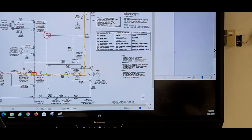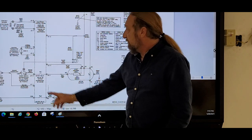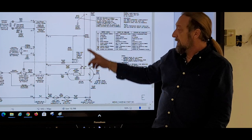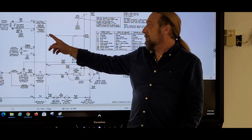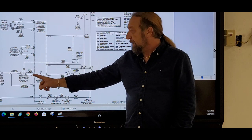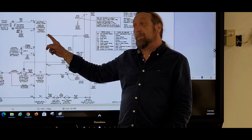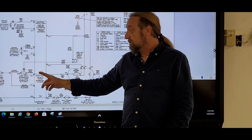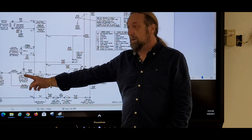Now, how come couldn't you also test the J42 to J41? J42 to J41. Yes, you could, but you're going through the motor. Oh, okay. You could do that, but here's a true neutral. I got you. And you know that neutral is good. So by going here, you're only going. We know this is good because the board's lighting up, but we said earlier that has to be good. If I go here and here and I don't have voltage, here and here, the motor could be bad or my door switch could be bad.